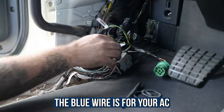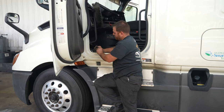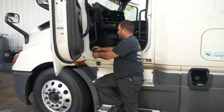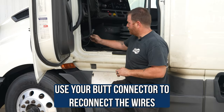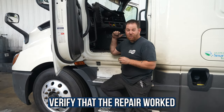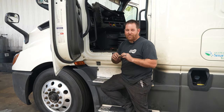Right here is the big blue wire — this one has just the blue wire, not the ground wire, and this is for the AC blower. You can see a little bit of heat damage. Usually you'll see where it's melted. What I do is cut this wire and cut the other wire end off the plug. Instead of trying to find a replacement plug, get a yellow heat-shrink butt connector, cut both ends, connect the two wires, crimp them, verify the repair, and confirm the blower motor is working at all speeds.